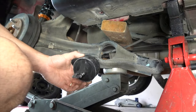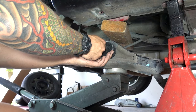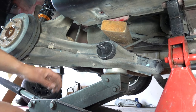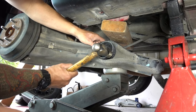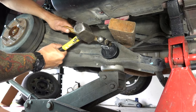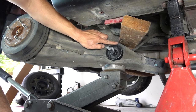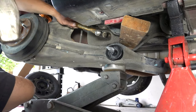Fresh out of the freezer — just remember the long side goes in. Stick it right in there and hammer it in. It's nice and cold and the metal shrunk so it should go in fine. What you want to do is get it flush on both sides, and it's good. Two hammers will let you get in there.